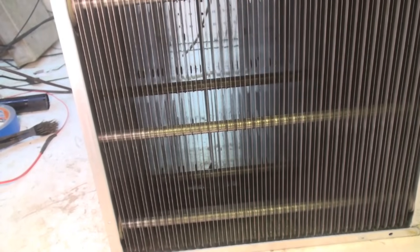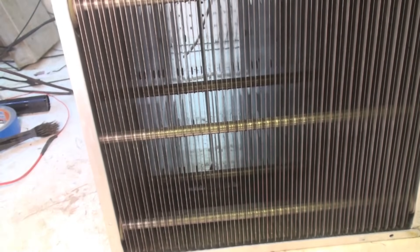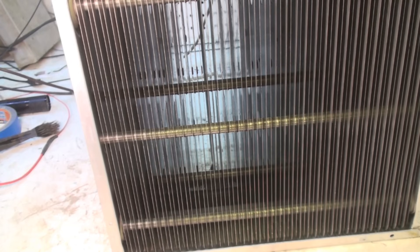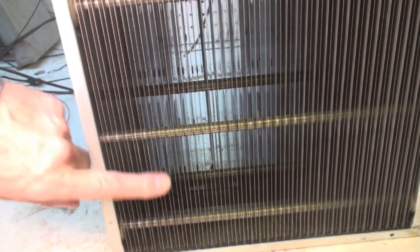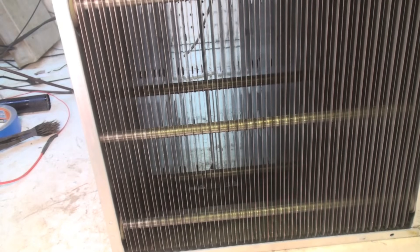All of these wires should be intact, one for each plate, so inspect those. I've turned this around and these are the collector plates here — they're closer together than the ionizing plates. Look to see if these are all straight and not bent. They sometimes get bent and they'll start sparking against each other.